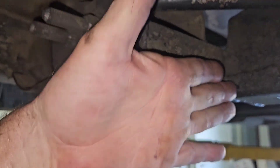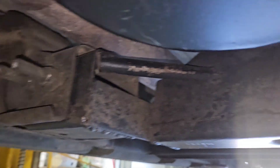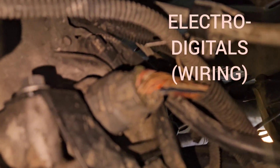Showing with my hand here just to give some reference of how far it moves back. The factory 60E plug works just fine — they're the same plug. But on a 60E it is on top of the transmission right above the pan, while on the 80E it comes in through the side.